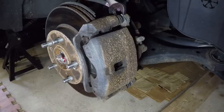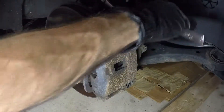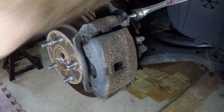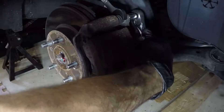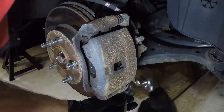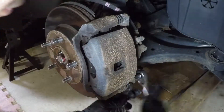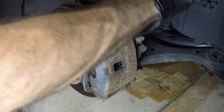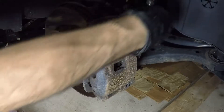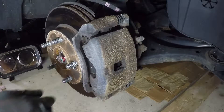The first thing I'm going to do is get this brake caliper out of the way. I'm going to hold these little metal tabs here with the 19 millimeter wrench and then remove the 12 millimeter bolts holding the caliper on. I'm going to do that for both caliper mounting brackets. I'm using a magnetic parts tray down there to hold all the pieces.